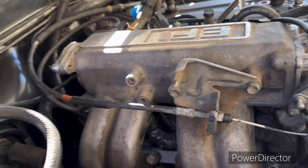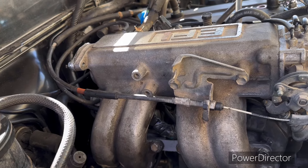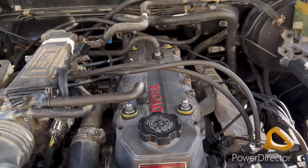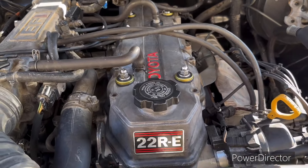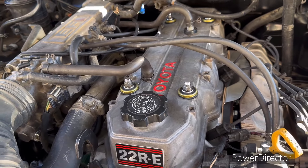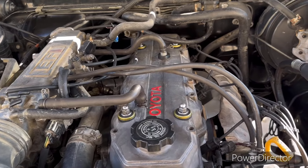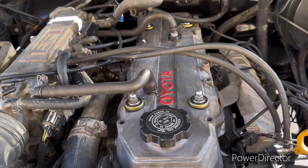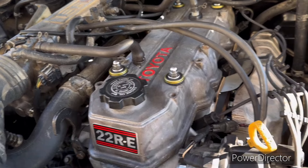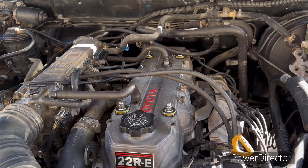I've got about 15 miles on it. I'm gonna drive it for a few days and then take it back — it's got just a little bit of click on the rocker arms. We adjusted it like the book said: rotate the motor, adjust it, rotate it, and checked it a couple of times. But that still doesn't mean we got it 100% perfect on the first try. Going to run this oil a couple thousand miles — kind of the break-in oil. We used assembly lube when we built it. After a couple thousand miles we'll change the oil, put a good Toyota filter on it with a check valve, and we ought to be back in business.